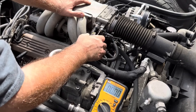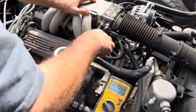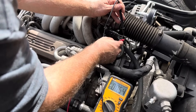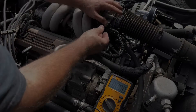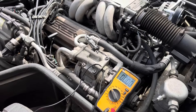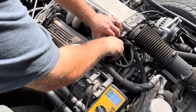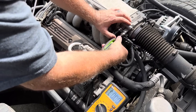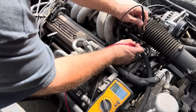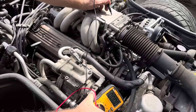When we tighten it, if it does move a little bit, gently tighten these up and go back and check it again. Let's see if it's staying — 0.54, so it went down a little bit. Now it's 0.56 again. I don't know the torque spec on these — they're pretty small screws so I wouldn't tighten them too tight. Alright, we stayed at 0.56.